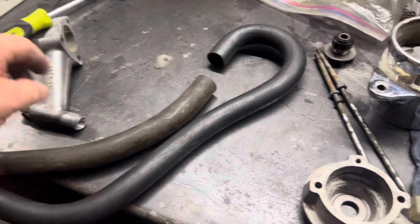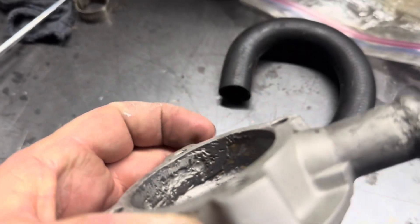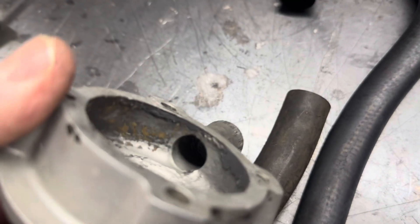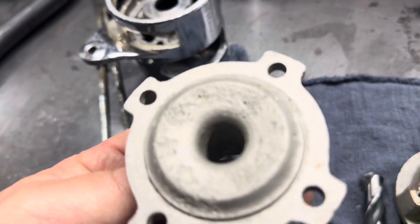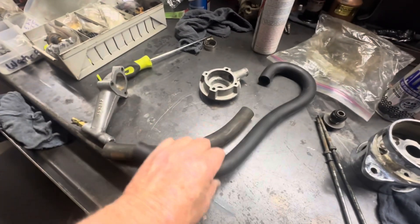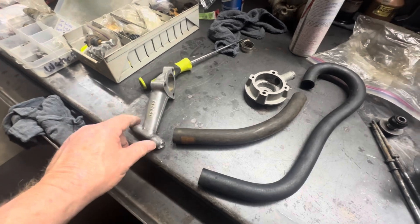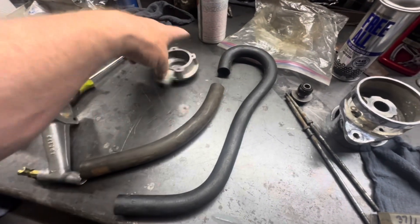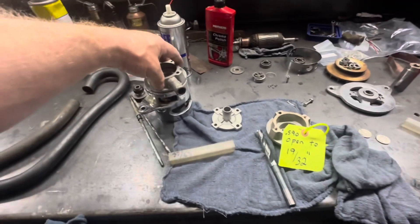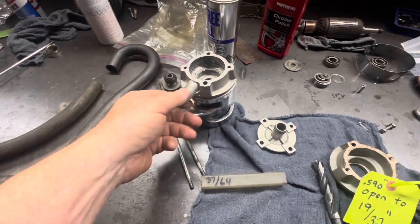Here are the two hoses. These hoses would fit from basically under the engine. This is supposed to prevent cavitation. And cavitation is what we see signs of here — it's this weird-looking wear pattern that you get inside of a water pump or wherever. It's really unusual looking and it'll actually eat a hole right through it. I'm going to check with my friends in Sweden and see which one they're using — I bought these from Saab Club Sweden or from the Netherlands. I'll see what the current train of thought is, whether to use this curved hose or that. You're going to have to change the orientation on your water pump based on whether you're going out at the top or the bottom of it.